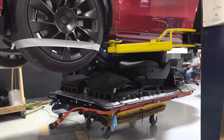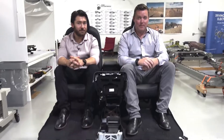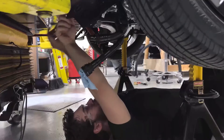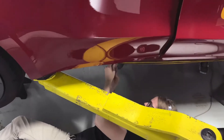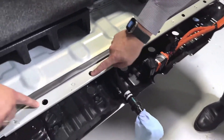As you can see, they managed to make it so it's fully detachable from the car — it even comes out with the seats, carpets, center console and trim pieces. All it takes is 38 bolts from the bottom and 4 from the top, and you can drop the pack down without issues. The connections and cooling lines are quite simple fittings as well.